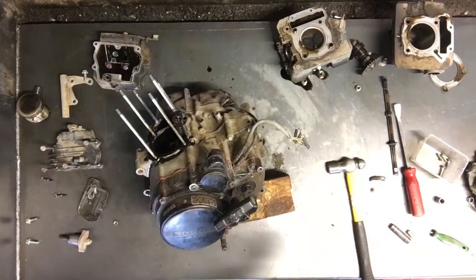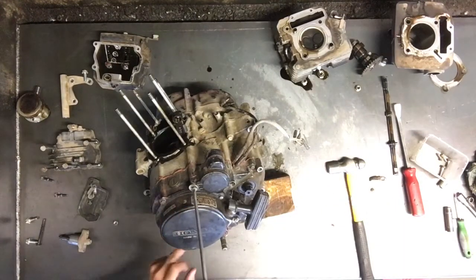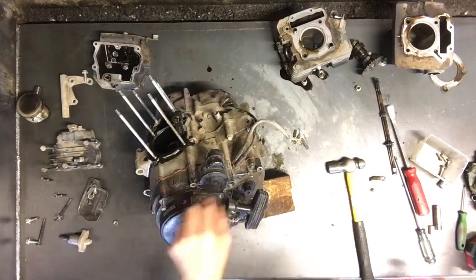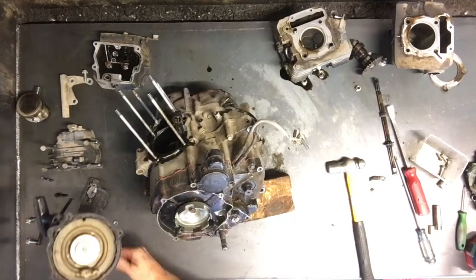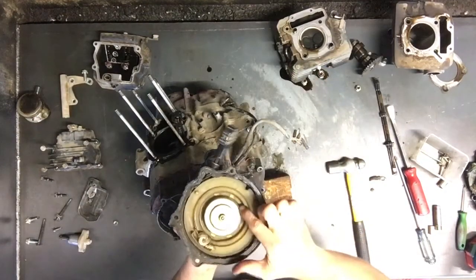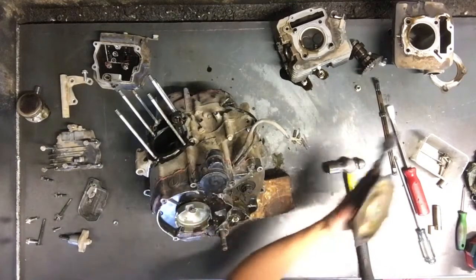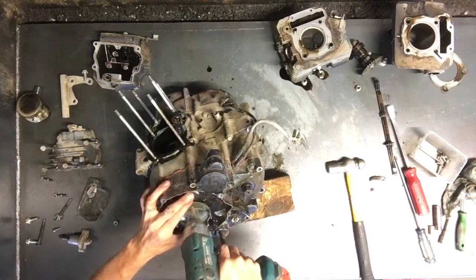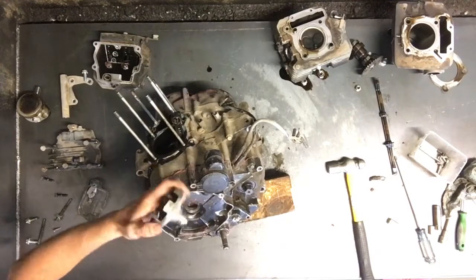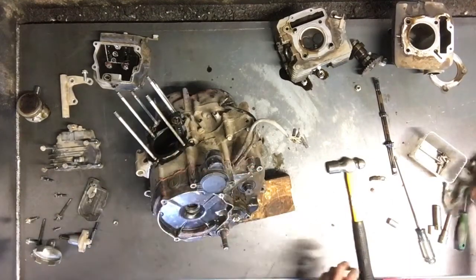Now on this one, this case broke at one time. So I've got 8mm bolts all the way around this recoil here. There's your recoil. When you spin a recoil, this arm should pop out — and that's what grabs that starter gear cup. Be careful — we'll pry on this recoil cup. It doesn't have to be that hard to get that off.